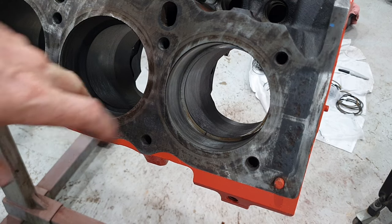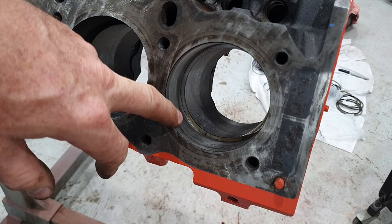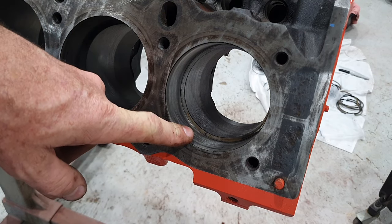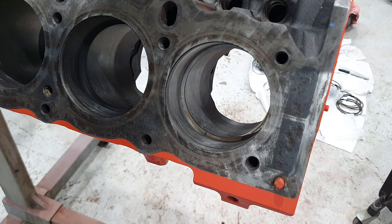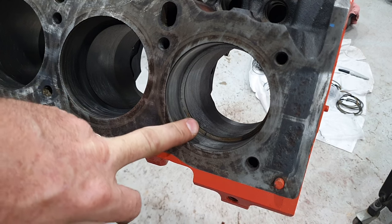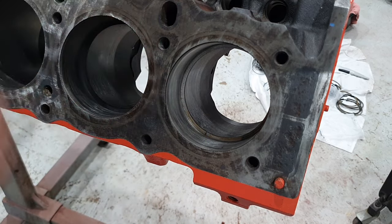So as a rule of thumb, you want to have about 4 thou per inch of bore if you're talking imperial, which you generally do for piston rings of older engines and piston sizes and bore sizes. So this engine is a Holden 253, so its standard bore size is 3.625, 3 inches and 625 thou, plus 20 thou over. You can see on the top of the piston, there's a little bit of marks on it, but a bit of old oil stain on it. It says there that it is plus 0.20, so it's plus 20 thou. That means this bore size is 3.645, so 3 inches, 645 thou. So if I have 4 thou per inch of bore, I should have about 14, maybe 14 to 16 thou. And this one here is coming in at exactly 16 thou.